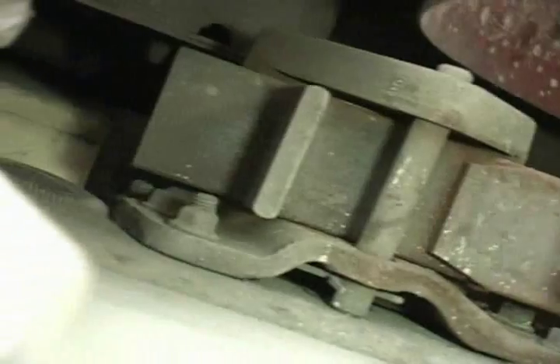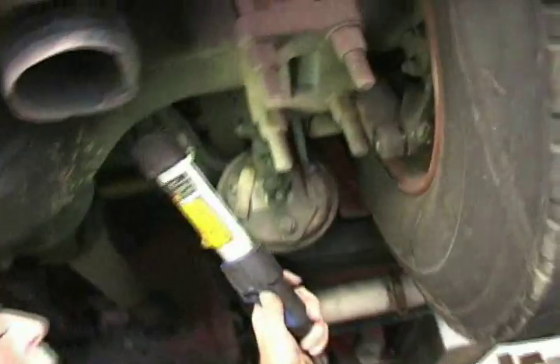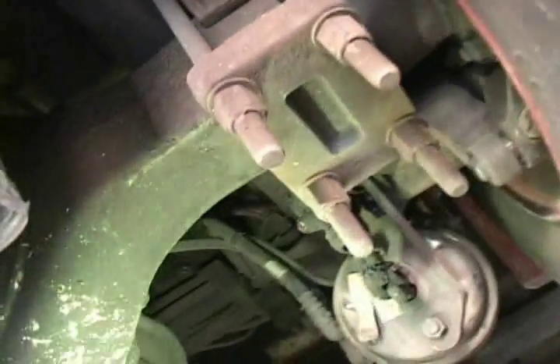Look at the spring stack on the left side and the spring stack on the right side — both the front spring hanger and the rear spring hanger. It's a little harder to see, but you can see the bolts right there that go through the frame. You're going to have to work your way around under the truck. In the back there's a little less clearance, but you can still get under here and have a look at these areas to make sure that there's nothing amiss.